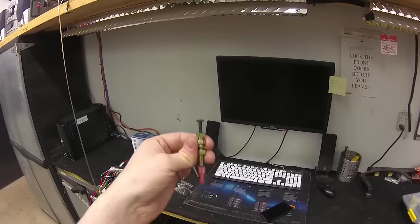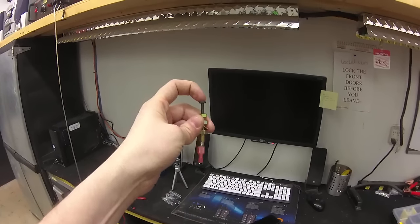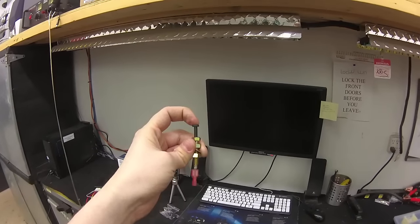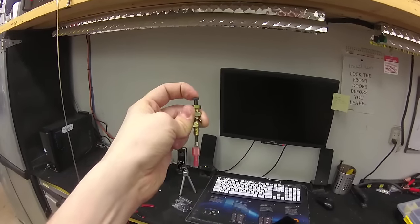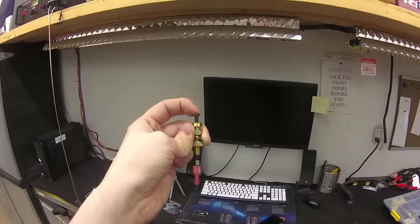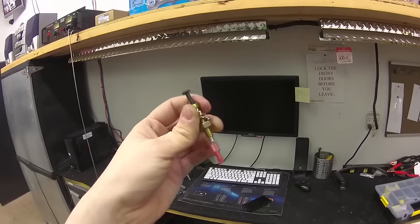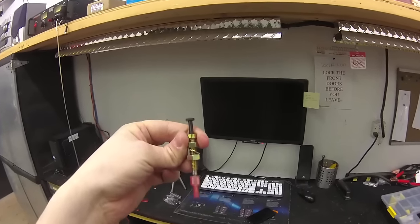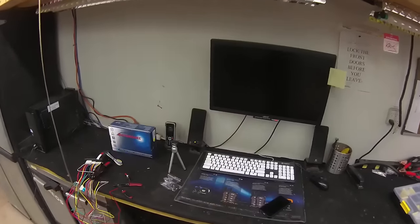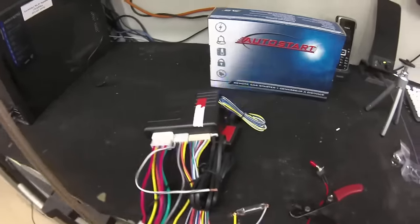The principle of a hood pin is basically a wire connected to the bottom — that's where this pink connector is. The shaft is made of plastic and the threaded portion is made of light gauge steel. When the hood is closed, the electrical connector on the bottom of the plastic shaft is electrically open, so the contact is broken. When the hood goes up, the pin switch springs up and contact is made to the threaded shaft, which is connected to chassis ground on the vehicle, which then outputs chassis ground to the remote starter. The wire that this hood pin is connected to on all AutoStart systems is gray in color.